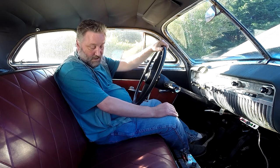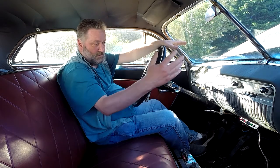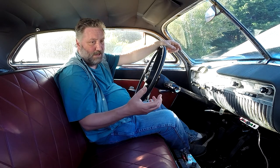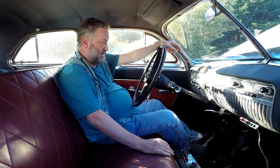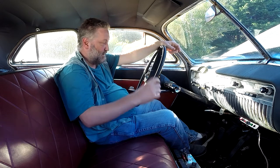I know it's going to be associated with the fact that we've got this 12-volt battery that operates only the ignition solenoid — it doesn't send power to the starter; we only use it to make that switch start the ignition process. The big long story behind that was three 6-volt ignition solenoids in a row, bought from two different locations, that would not be held down by six volts. Using a variable power supply, we had to go to eight volts before it would properly hold itself down. With just the six-volt supply, it was cycling, which is a problem.